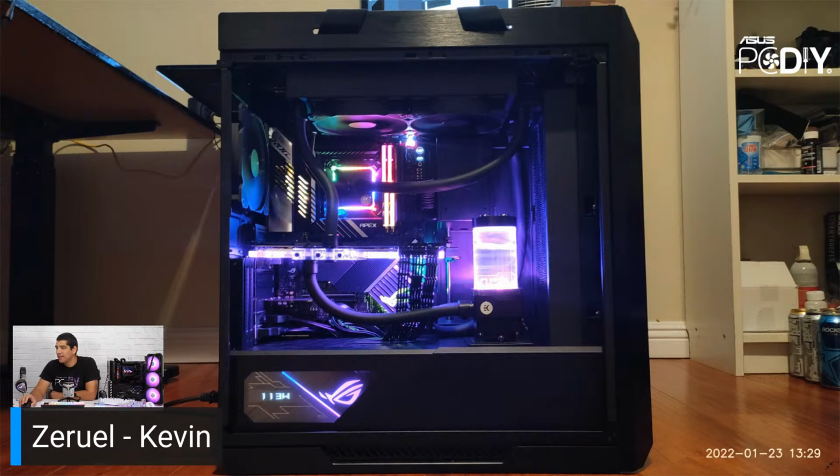And let's see right here. Core hardware we've got in there. So he's running an 11900K overclocked through ASUS AI overclocking. That's all in a Maximus Z590 Apex board. That's a fantastic combination. With per core overclocking, in that custom water cooling loop, I wouldn't be surprised to be seeing 5.3, maybe even 5.4. So you're definitely taking a very high level of performance out of that 11900K.